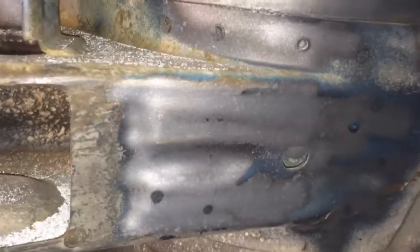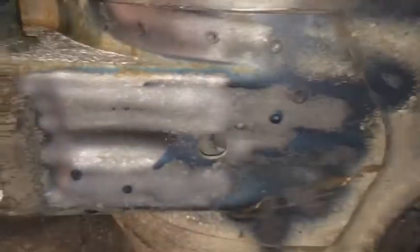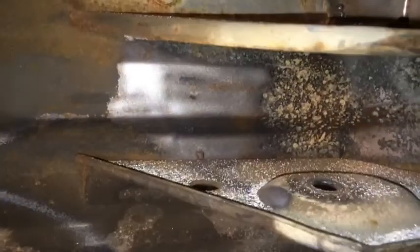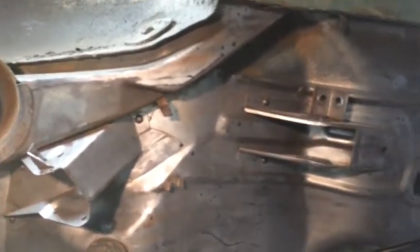With most of the rust done, I want to try and get some paint on, so I just bought a sandblaster. I sampled a little bit here and there - now I'm going to sandblast the bottom and then put some KBS on it. After about 25 minutes of sandblasting and about 25 kilos of glass beads, that's how much I got done. The machine was starting to block up a bit, so I think I'm going to have to get a better filter for the air compressor and then get back into it.